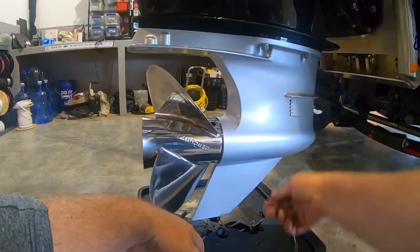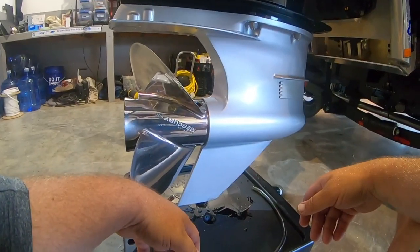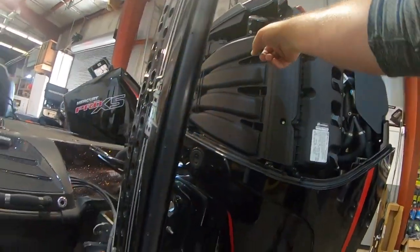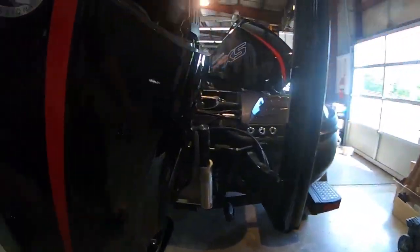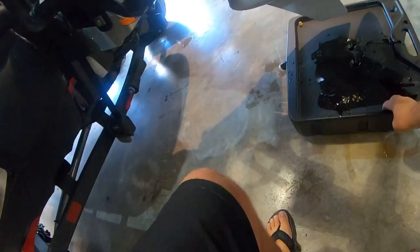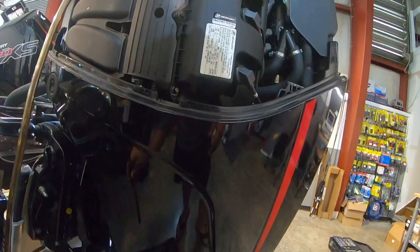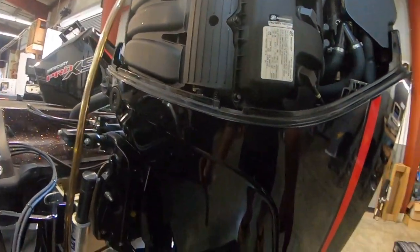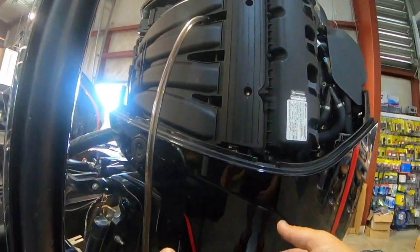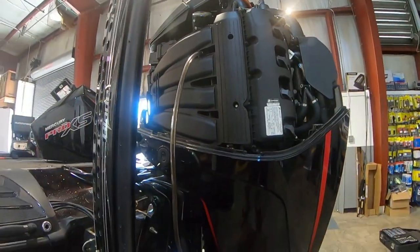So now we've taken off the clear plastic tubing on the plug — I'm just going to leave that open for now, but we're going to have to close that obviously when we're done. We're going to go ahead and change the oil filter here, remove this plug, and then put the clear plastic tubing there so it'll make things really hassle free and clean. This one's going to be a little bit dirtier just because I don't have the longer hose. I would have two different hoses — one that's short enough for the oil drain plug, and then one that's quite a bit longer, maybe a foot and a half longer for the oil filter. There's not going to be a ton of oil that comes out of there, but just enough to make things a little bit messier. With the proper tools, you can actually do it with absolutely no mess at all.